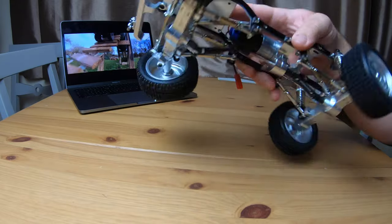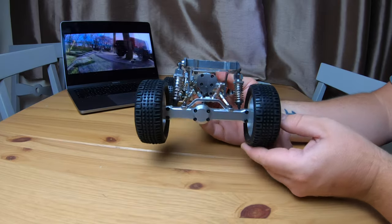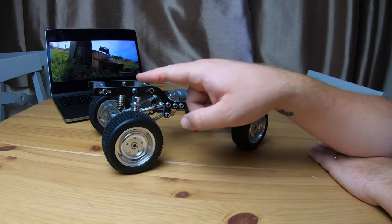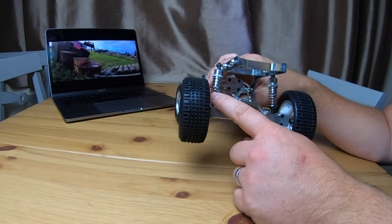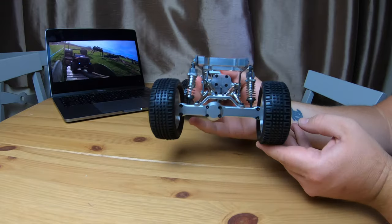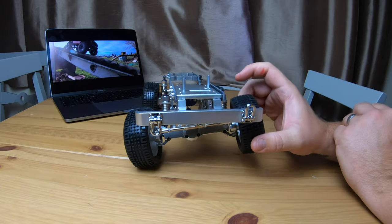I've heard some people mention these shocks are no good, and with similar ones you don't get much movement — there's not much flex. It does sit a little bit higher than a stock one, and you can get adapters to bring the height down. They are oil-filled; when they arrived they had only a tiny bit of oil in them. I've taken them all off, put oil in, and bled them properly to get the air out. They actually feel like quite nice shock absorbers now, and two days on they're not leaking — that's a bonus.